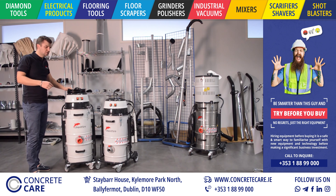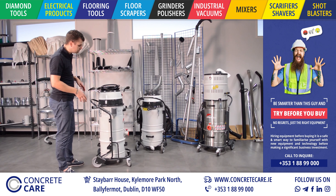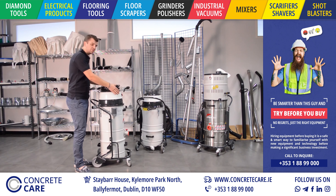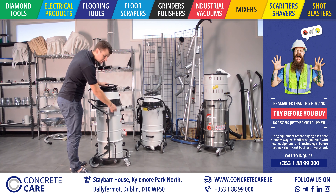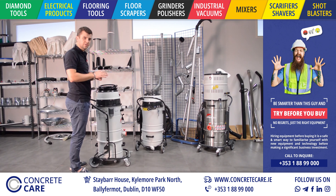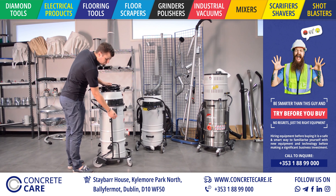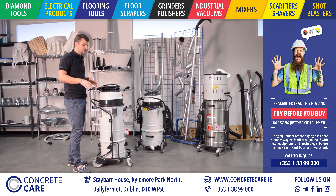Let's go into more detail on the Dustop now. With the Dustop filter cleaning system, you can clean the cartridge filter easily in three steps. You just keep the vacuum on, close the cap on the suction inlet — or just put your hand on the hose you're using to vacuum materials — and then do this motion four or five times. It's very, very fast and very, very easy.